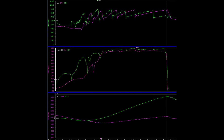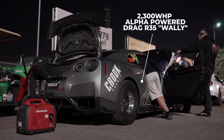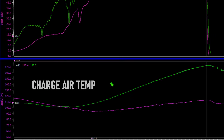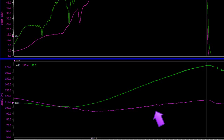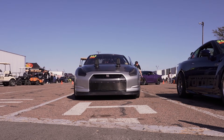In a real world scenario, you can see this graph here. This graph is actually from Dave Roeschneider's car — Wally, his R35 GTR — making about 2,300 horsepower roughly. We have two different lines here. The green line is when the car was air-to-air, and the purple/pinkish line is when the car was switched over from air-to-air to air-to-water. This is on similar power settings with very similar boost. During the actual quarter mile run, the car was almost 60 degrees cooler on the charge air temp. That there is a very good example of why air-to-water is beneficial.